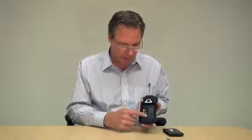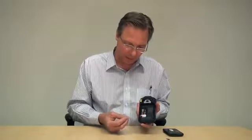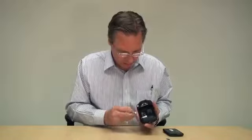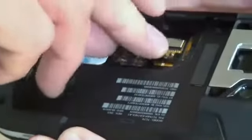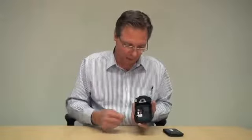We'll also put in a nano SIM. As I mentioned, there are two nano slots and a mini SIM slot. When you get the device, by default, the slot closest to the edge is the nano SIM-1 slot — this is the default slot that is used. I'll show you how you can change that and select a different SIM slot. This device I'm holding has already been configured to use the mini SIM, and I'll show you how to switch it to the nano later. The nano's notch points basically down and to your right — my left. You push it in like so. It just sits in there. There are no covers or latches that go over these.